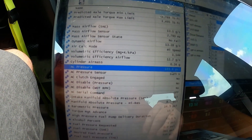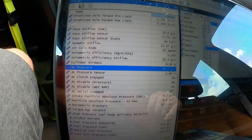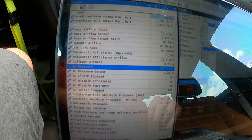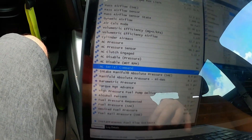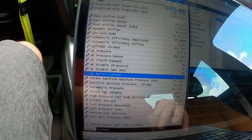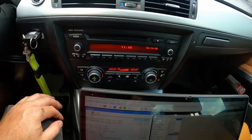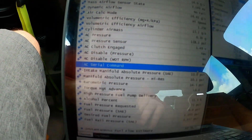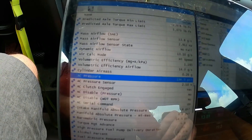Next, scroll down to AC — we are reading AC pressure with our factory GM AC pressure sensor, which is tapped into the BMW rail. We'll show the adapter and the wiring diagram. Right now we have serial AC command off. When we go ahead and turn on the BMW AC, you'll see that the AC serial jumps to 'on' and our high side pressure starts to build.